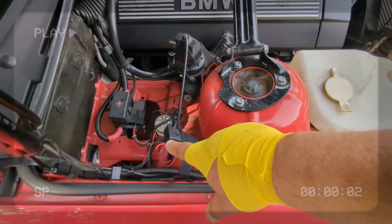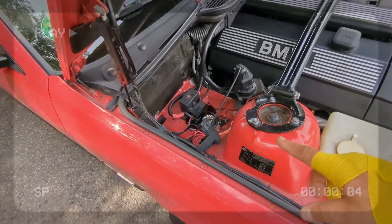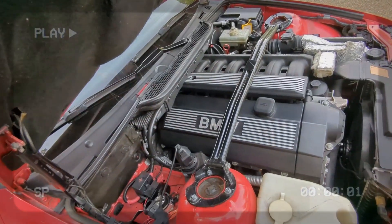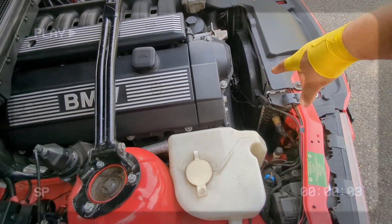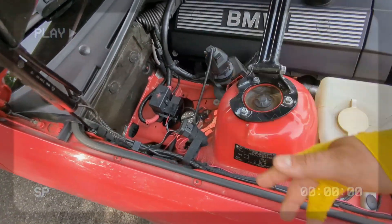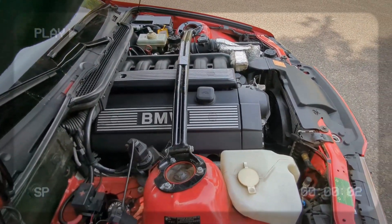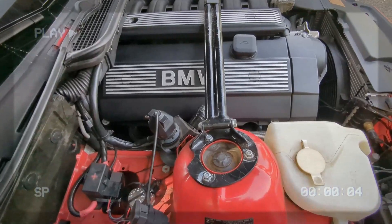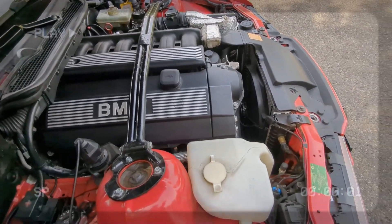For the control I went with the capillary tube temperature probe and thermostat, plus the manual switch inside. You do have to run some wires through to the inside - you take off a panel, there's a hole, run the cables in. That's the most time-consuming part. Removing the clutch fan and putting the e-fan in is like a 10-15 minute job. Running the wiring with the relay you can mount wherever you like. Total cost for a universal fan and wiring is talking about a hundred bucks, maybe more for a higher-end fan.